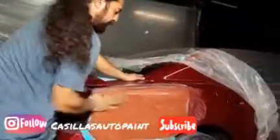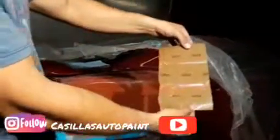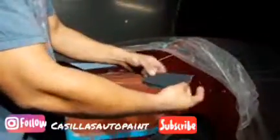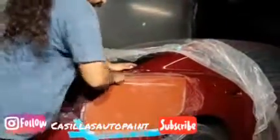All right, guys, so check this out. Basically, this is your normal wet sanding sheet. It's a 600, and I always hold them folded over like this. That way you got 3 panels you could sand with. So basically make sure it's wet. And you can go in whatever direction you want. The way I was trained is I like to go in a circular motion.